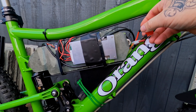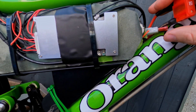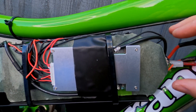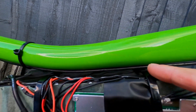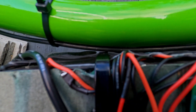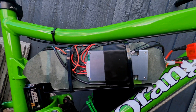Here's some of the work we've previously done: we've got an upgraded 50 amp fuse, which is a great idea if you run a phase runner at higher power because they tend to blow. We've also got the brand new BMS that's been relocated from on top — as you can see, the frame clearance isn't a lot — and we're going to be running a couple of straps or cable ties on this system.